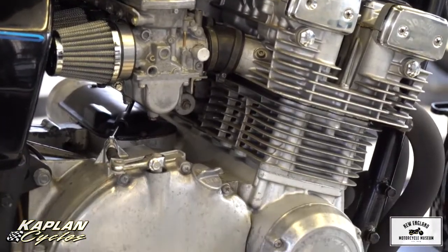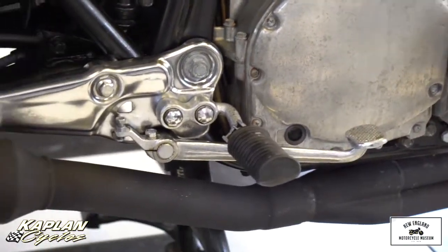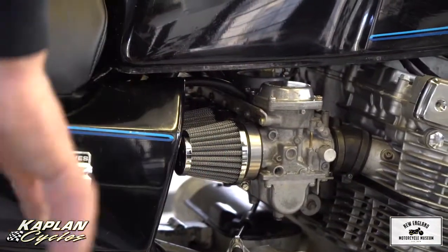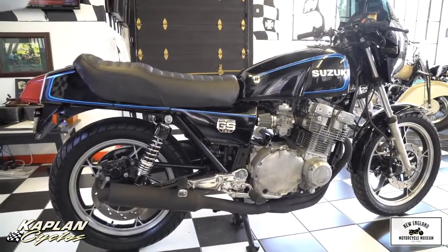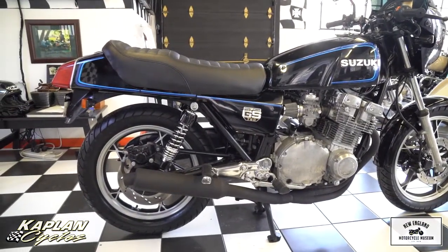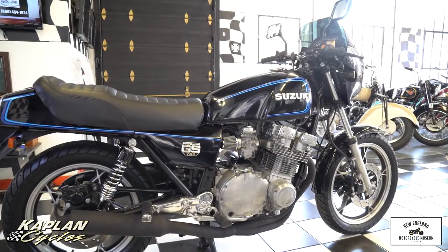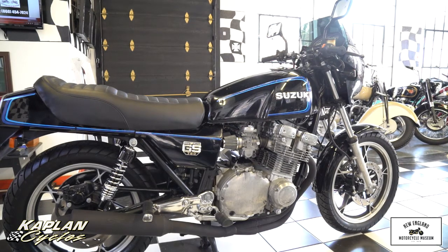So basically, the entire fuel system has been completely customized with an open air box and open individual air filters in the Stage 3 kit, but also tuned to perfection and completely rebuilt. That's a big job, okay? It has a 4-in-1 Pro Sport exhaust, brand new fuel, brand new spark plugs, and all electrical components and connections have been gone through. We also repaired the starter solenoid, disassembled and cleaned the starter button, installed a new solenoid in it,